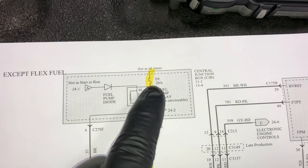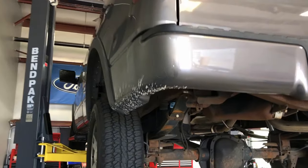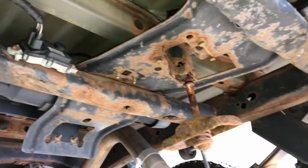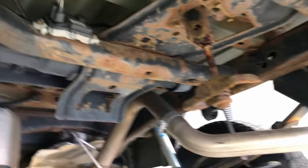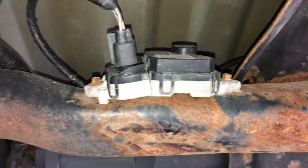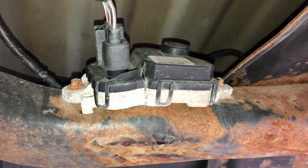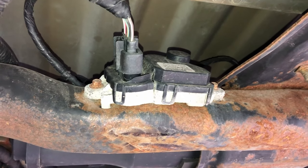Let's go underneath and change it. Come under the truck at the rear and look above the rear axle at the last crossmember — you'll see it right there. Lower the spare tire out of the way using your roadside tools to gain access. Once underneath, you can already see the problem: this one corroded so badly that rust jacked underneath and cracked it in half.